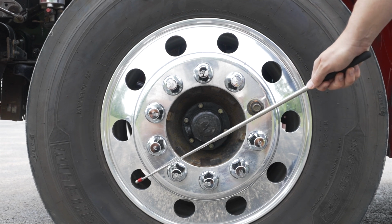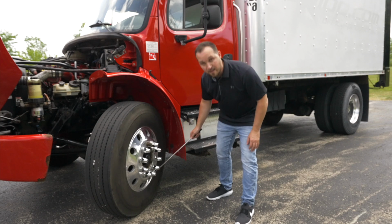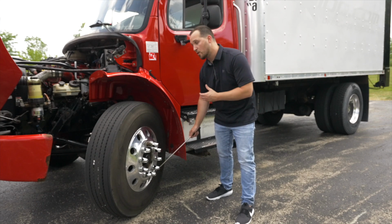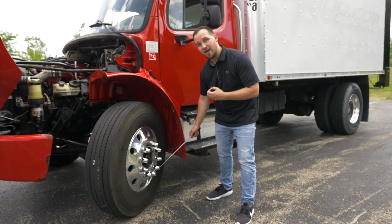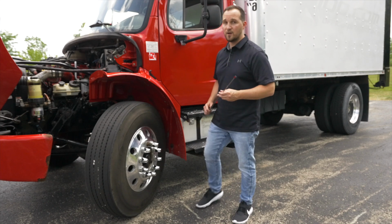We're going to find our valve stem on the wheel and make sure the valve stem is not broken, not cracked, on secure, cap is tight. We would check our tire pressure with the valve stem to make sure there is at least 105 psi of air on the front tire.